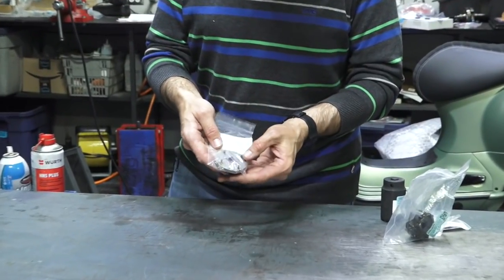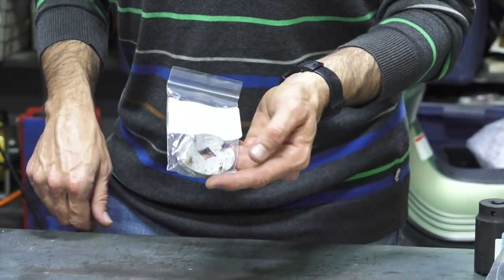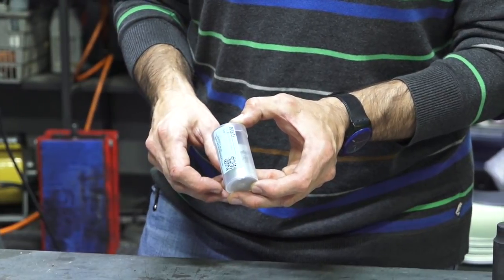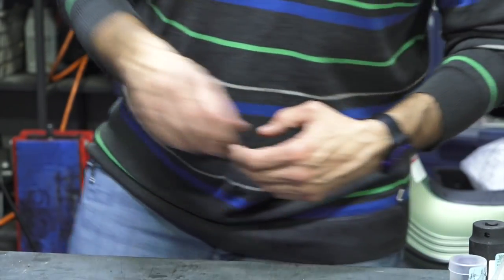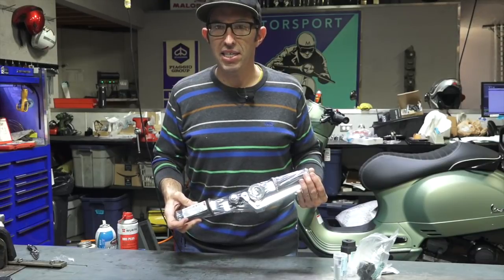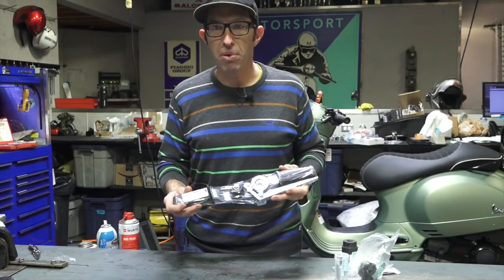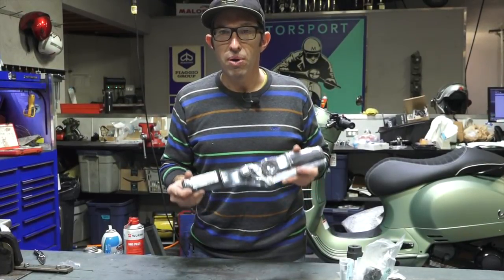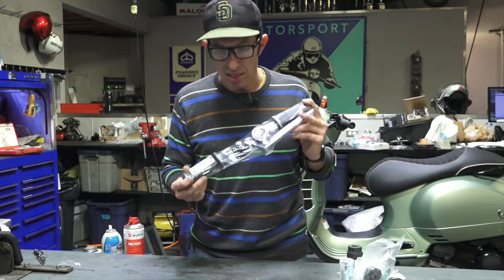Tool 63 is a four-pin custom-manufactured tool for removing bearing retainers found on 1950s scooters. Tool CP is a puller specific for the small frame clutch, and there's also a variation for the Vespa GS and SS to remove the clutch. If you do a full restoration on your vintage Vespa and want to replace the aluminum trim on the leg shield edge, you'll definitely need Tool LST — a roller that you can crimp over the aluminum trim onto the edge of the leg shield. It takes some work to set up, but this is the tool to have for crimping that edge on most vintage Vespas.